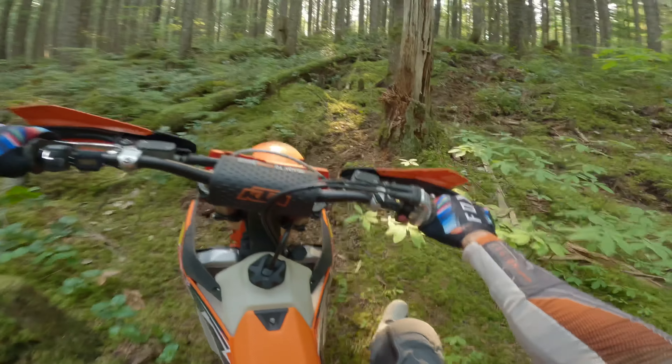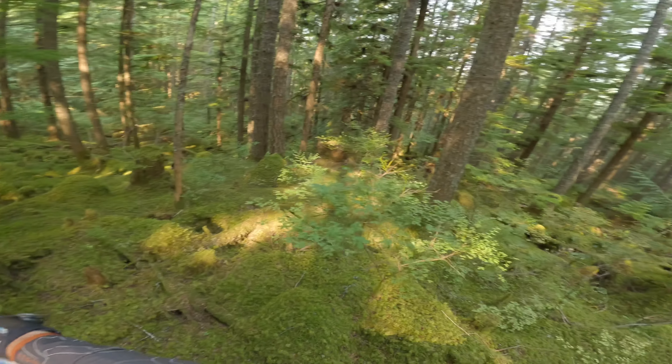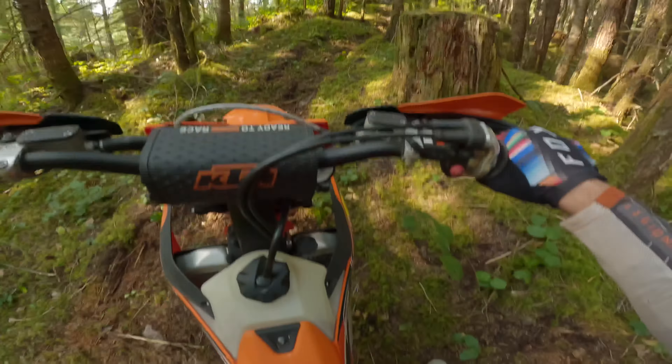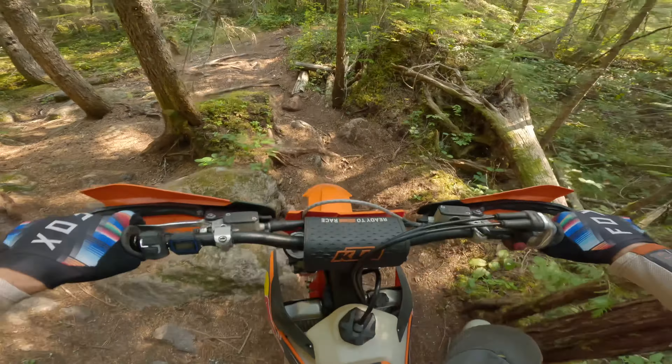First off, I think the bike is great out of the box — lugs really well, has a ton of power, even manageable. I've always thought of myself as a horrible tester, someone who doesn't really notice much difference in setting changes. But all that being said, this makes the bike better for the type of riding I'm doing. If you ride higher speed and aren't lugging much, this flywheel isn't going to help you much. But I haven't really found it detrimental to high-speed riding either. For someone who enjoys technical trails, it's a noticeable improvement — it still has all the power but delivers it smoother, especially off the bottom end. Kind of making the XC a bit more like an XCW, which has a heavier flywheel, but the XC has more horsepower — so maybe the best of both worlds.